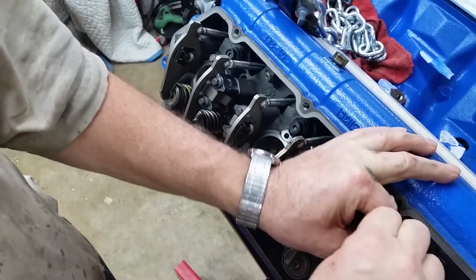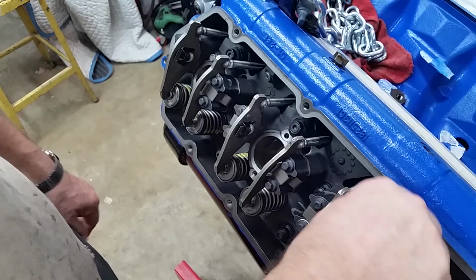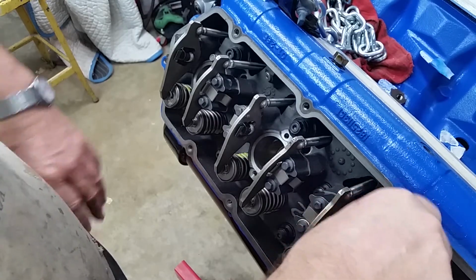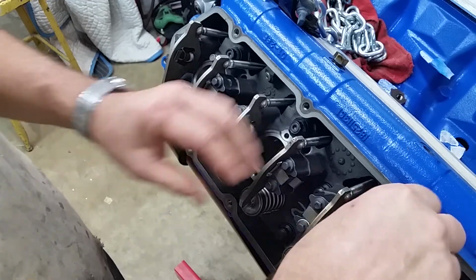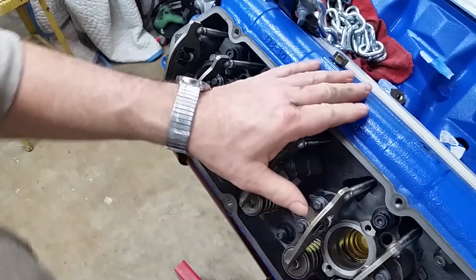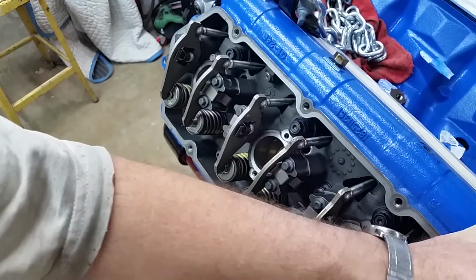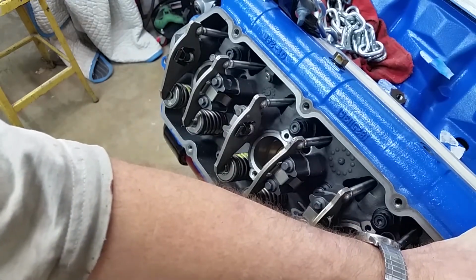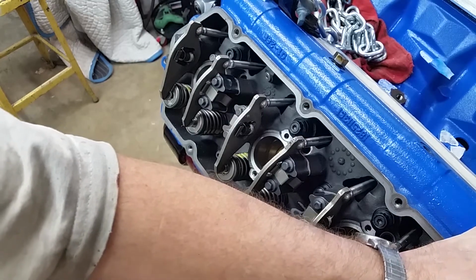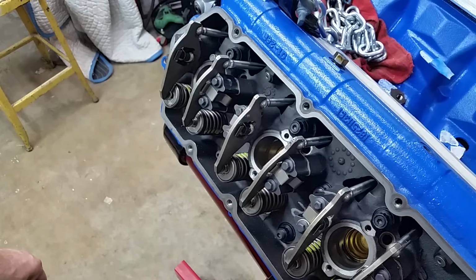I've been waiting to get on this engine for so long. Finally got to it and was getting ready to put injectors in. Started researching fresh injector failure rates. Come to find out, there's quite a few. This one's off camera, but it's no big deal. It's just a glow plug. There's quite a few recorded failures of new injectors in old cups, and the cups crack, just from the sheer stress of removal and install of a new injector. So it's interesting.